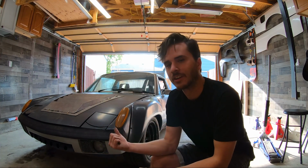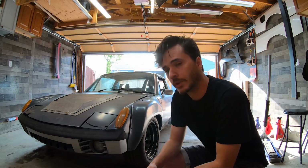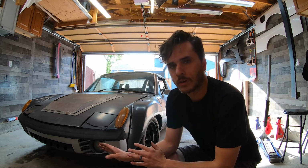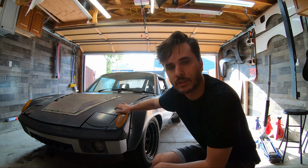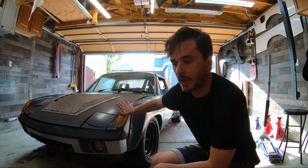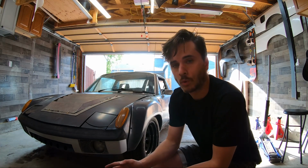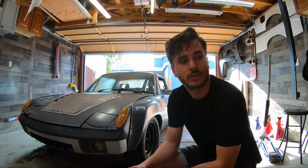I've got a ton of work I need to get done on the 914. I've got a track day tomorrow morning, and I haven't really driven the car besides what you guys saw in one of my last videos. The car does work and everything, and I raised the front suspension and fixed some issues that I had with it last time I was working on it, but I want to raise the rear as well. It's just too low, so the geometry is not working correctly, but I'll raise the rear to match the front, and then I'm going to do an alignment on it.